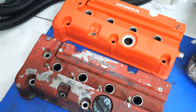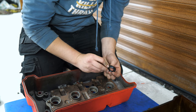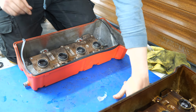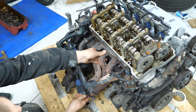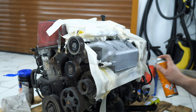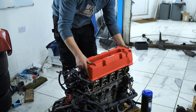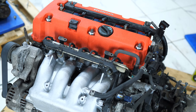It's not just about that nice new shiny rocker cover — we had to buy new gaskets as well because once this engine's in, we really don't want anything leaking. Now seemed a good point to take off the old exhaust manifold as well, as we're not going to be using this original one — we'll be replacing it with a 421 manifold. We also gave the inlet manifold a little bit of a clean-up with some high temp paint. All that was left to do was slot the new rocker cover onto our engine, get it bolted down, and its new look was complete.